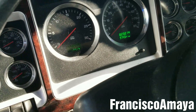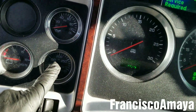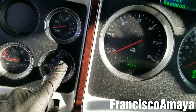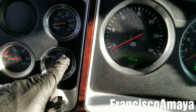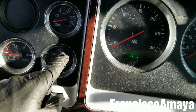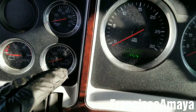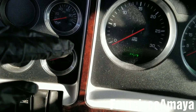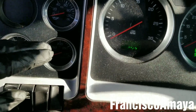What is happening to this truck is that when the engine is running and it's going over a hill, the temperature goes and stays at 210. 210 is the temperature when the fan gets activated — it has to lower itself because the fan gets activated, but in this case it stays at 210 all the time, no matter what, as long as the truck is going on a hill. As soon as it finishes with the hill and stays on a level road, it will just drop the temperature.